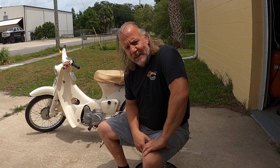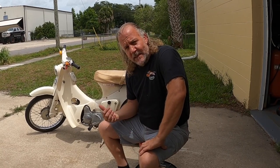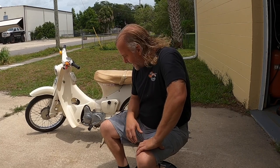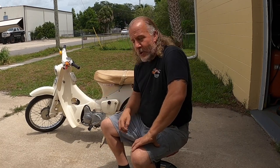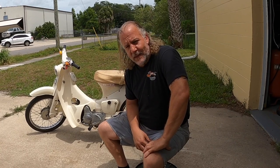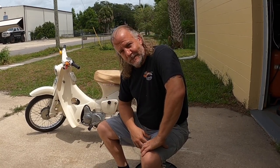I did free it up, but it needed a piston and rings. Sent the top end out to Millennium. Had it bored to match my piston, did a valve job, put the top end together, hit the starter button, nothing. Starter was frozen, can't get them anymore, took that out, sent that to an Amish Mennonite old-timey starter place, and they rebuilt it. Took them a long time, but we got it back. Starter turns, hit the button, engine doesn't turn.